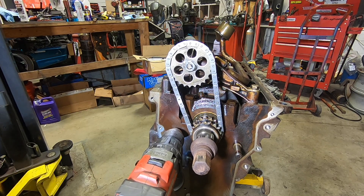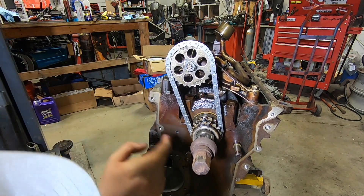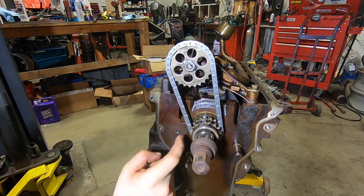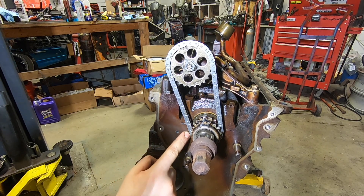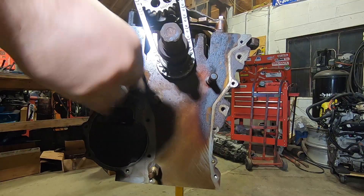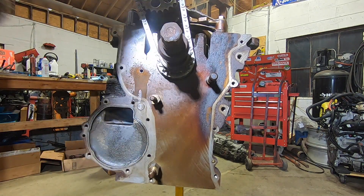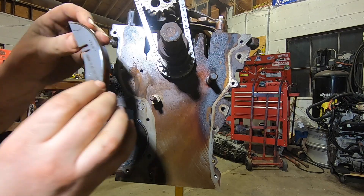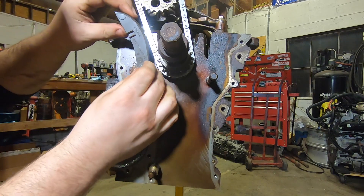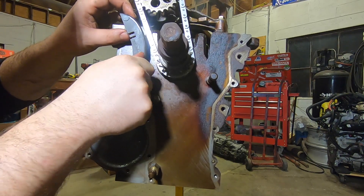A little center punch action. You may be asking how deep to drill — in this position you can drill clean through the block right to the back side, so you can easily clean out any chips. You really can't go too deep if you drill where I told you to. If you drill too far in, keep in mind you have a bearing cap bolt coming through there — you don't want to be close to that or you'll weaken it. Two and a quarter inches in seems to be the ticket. The shoulder bolt drops through and comes perfectly flush to the bottom. I'll put the part number for these bolts in the description below — they are critical to making this happen.